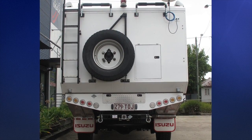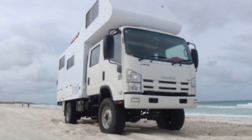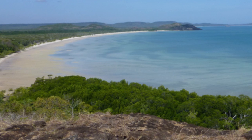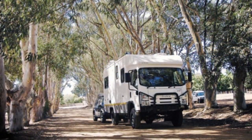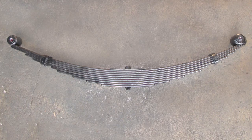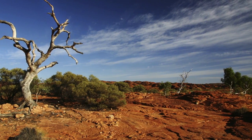We can also be sure the ride will be dramatically improved, especially going over the terrain he plans to explore. The owner shares his experience: he bought the new NPS 300 cab chassis in 2012, had super single tyres fitted, and over the next 18 months had a camper built for the rear end permanently mounted on the truck. A trip to Cape York in September 2014 highlighted the shortcomings of the Isuzu OE suspension — luckily he had fitted suspension seats prior to leaving. Half an hour of corrugation saw the shocks fade to zero dampening, constantly hitting the bump stops. Driver input was tiring just to stay on the track, and even on bitumen counter-steering against bump steer was exhausting. Suspension Supplies Australia have now fitted new spring packs, Saks shocks, and all other componentry. Driver input has now reduced dramatically to a level where he can look at the views and not just the road. One day turnaround — driven in, drive out.